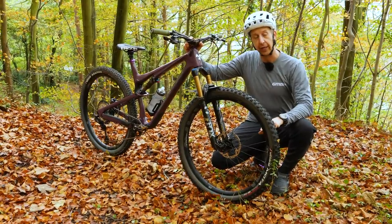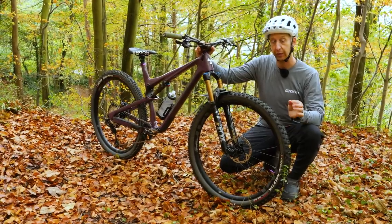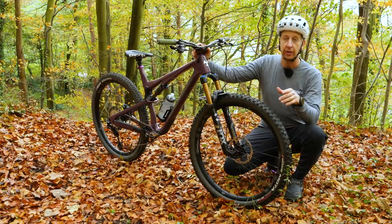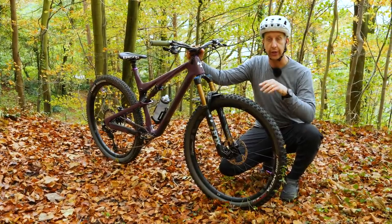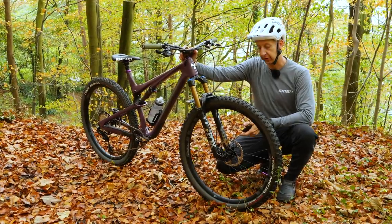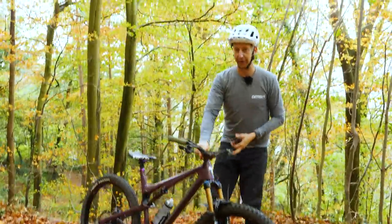What you could do if you have got that issue is to just loosen each spoke by half a turn, put literally a tiny drop of oil, and then tighten it back up again. I'd only go that far if that's what the problem is and if you're comfortable working on your bike like that. Pretty much, that's where the creaks come from on your spokes. You've got to think your wheel is almost a living thing — it kind of moves around the entire time.